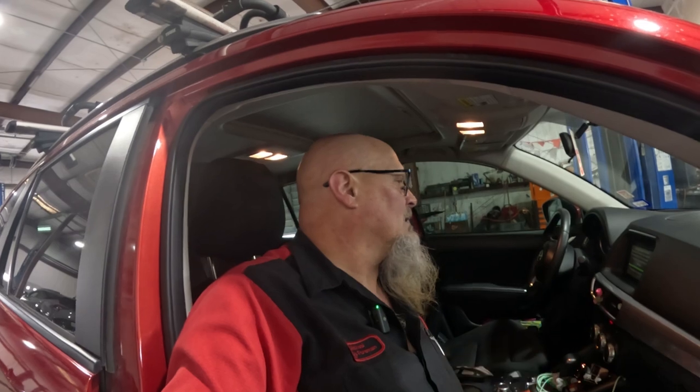And then we're gonna have a lot more wiring than what we need, because we're just gonna go from down here to up in this dashboard up here to the Connect Master unit. So a lot of that wiring is just gonna be kind of wound up, and we'll zip tie it, you know, so it doesn't go anywhere, and maybe use some of those felt or foam tape things to kind of tape it to the side. That's what Mazda wants you to do, so that's what we'll do. So we'll get back whenever this thing is finished updating.